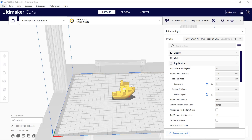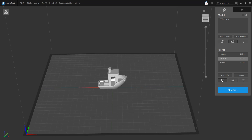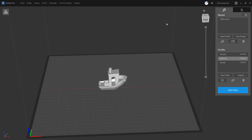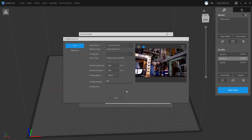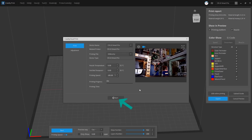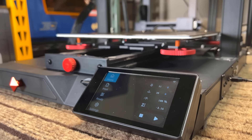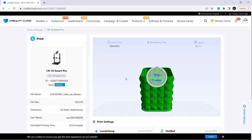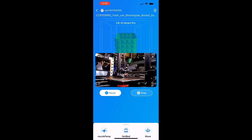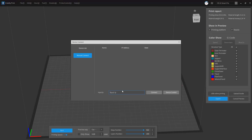Two: for computer slicers you can use Cura, Creality Slicer (an older Cura skin), or the new Creality Print. The new Creality Print is functional but has some glitches — the camera connection freezes occasionally, and the program stops responding when an upload is almost complete, though restarting fixes it. Sometimes when I wanted to start a print job from the software it would keep loading and nothing would actually start — even after waiting over 10 minutes. This was very unlikely to happen when using the web interface or mobile app, so Creality Print still seems unstable. There is also an option to print directly to your local network printer instead of using the cloud.